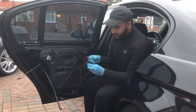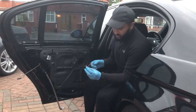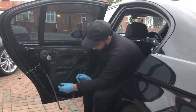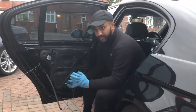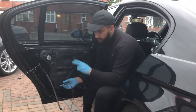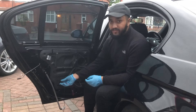My wires are nicely taped up. Now we want to place our inverter somewhere on the door card. We can get a small screw and drill it into the foam — place it in an area where the door card is not going to be pressing onto the inverter, or else you won't be able to get the door card back on. Double check that we've got enough space.